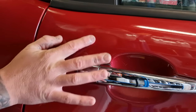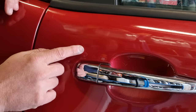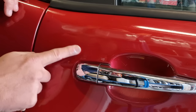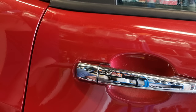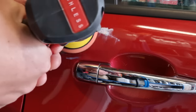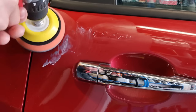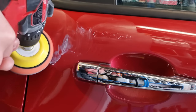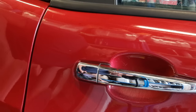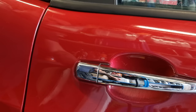Once I've let the panel cool down — because it does warm up when we're buffing — I'm applying a very small amount again to a couple of the deeper scratches. I'd probably recommend doing this perhaps three times on certain car manufacturers, though I usually only do it twice. Don't forget that when you're buffing a localised area you are removing some clear coat. Depending on temperature and time of year, I'm leaving it about two minutes to dry — not long at all. And as you can see, that's looking absolutely fantastic.